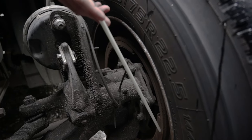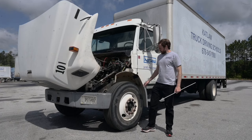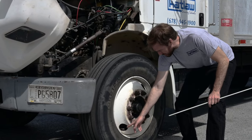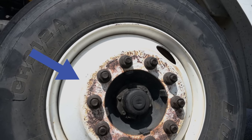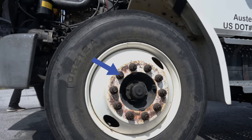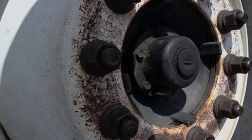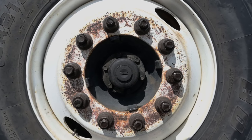Steer wheel group — front tire: The tire tread must have four thirty-seconds of an inch or more of tread depth in all grooves. The tread is evenly worn with no abrasions, bulges, cuts, or other damage to the tread or sidewalls. The tire must be beaded properly to the rim with no leaks around the rim. Say I would check the tire pressure with a tire pressure gauge at the valve stem. The valve stem and valve cap are not missing, broken, or damaged, and are not leaking. Rims: Not damaged, not cracked, bent, or broken, and have no unauthorized welds, and they are securely mounted. Lug nuts: Securely mounted, not cracked, and none missing. There are no rust trails or shiny threads that would indicate looseness or cross threading. The bolt holes are not cracked or distorted. Hub oil seal: Securely mounted, not cracked, bent, broken, or damaged, and not missing any hardware. Not leaking and the oil level is correct — I would check this visually with the sight glass or remove the plug and check with my finger.